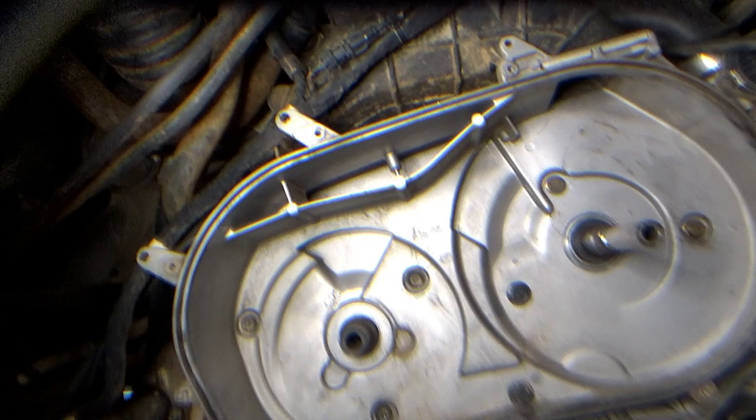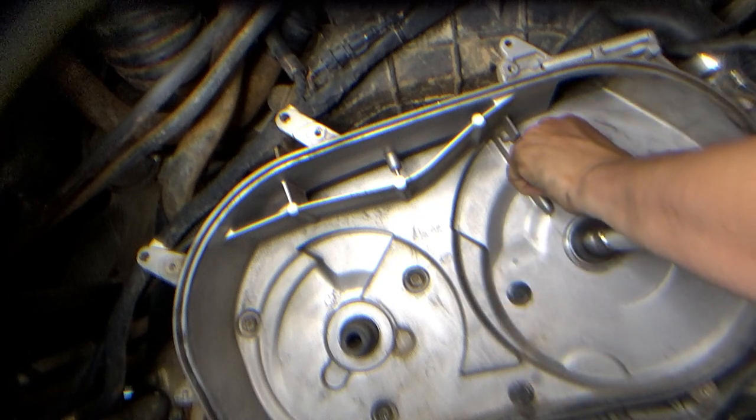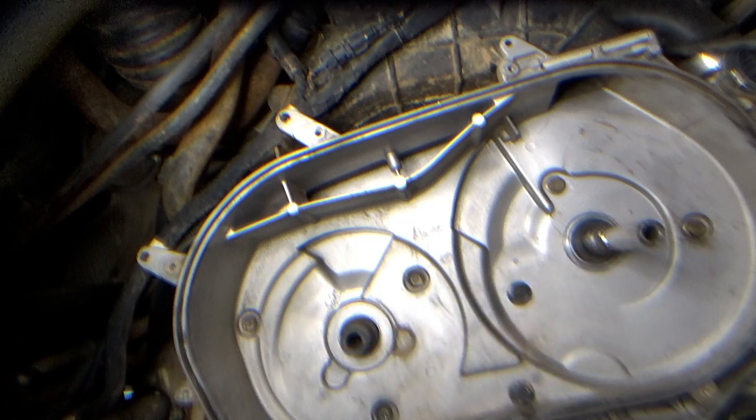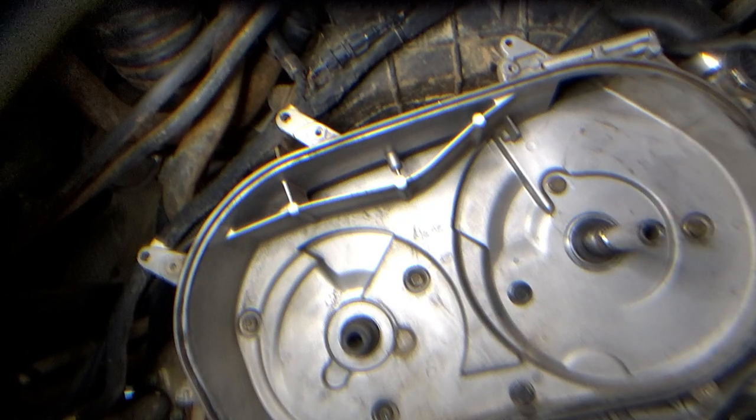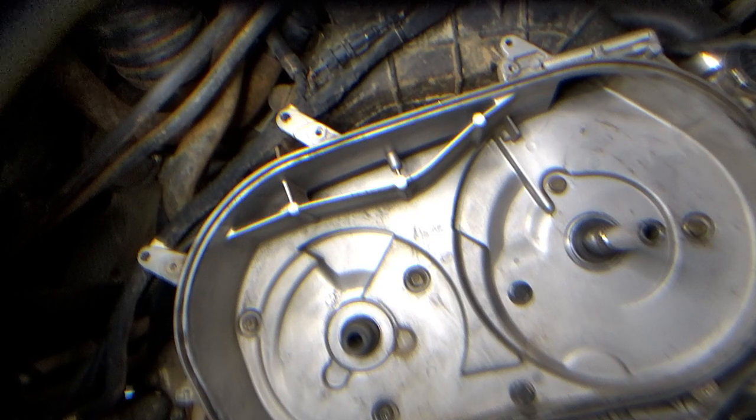For a few people that wanted to see how the alignment goes: all of these bolts are still loose, and there's an alignment tool to get the spacing and alignment right. But let me show you how much movement there is — I mean, it really doesn't even have a lot of movement. I'm going to do like a few of my friends did and just tighten everything down. This one does have the aluminum backing plate behind the clutch cover. I'm not going to say that you don't need to align these; I'm just going to say that I'm going to do it without it, and if I have any problems I'll let you know.